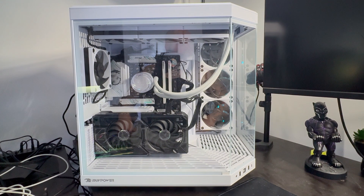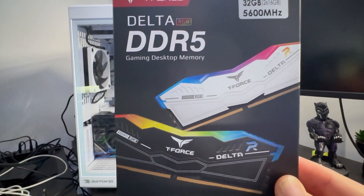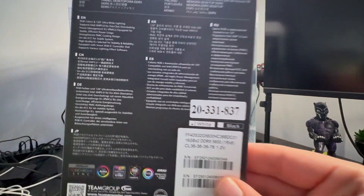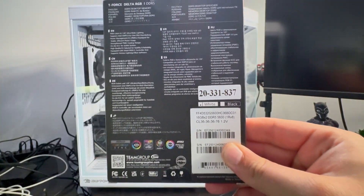When we talk about speed — and I'm going to show my actual computer here in a second — you're going to have to go to your motherboard's website and put in the extra RAM you're buying to make sure it matches up with the slots and the RAM you already have. Each RAM is different, but you want to make sure you are working at the same speeds for all your RAM sticks. That is very imperative before buying new RAM sticks. I ordered the DDR5 ones and I'm running at a speed of 5600, which you can see in the top right-hand corner.